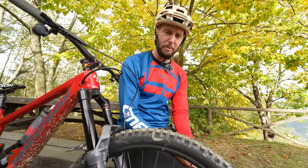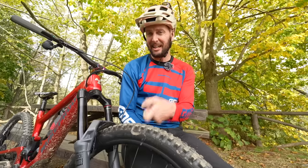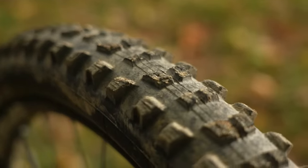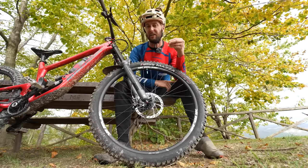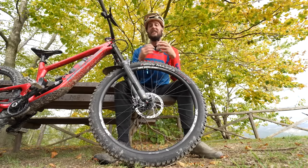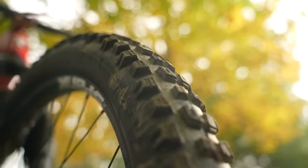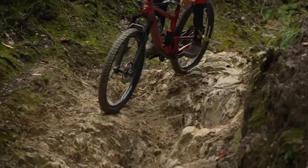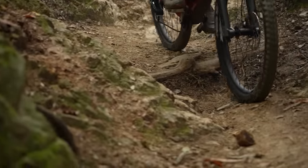It's not quite as simple as just letting a few PSI out of your tire. A lot of things can affect it, such as type of tire, size, and casing. There are all types of tires for all types of disciplines. We're obviously out here smashing enduro laps in Finale, so I've got an enduro casing tire. A tire's casing is measured in TPI — threads per inch — essentially how many threads are in per square inch. A lower TPI means the threads are thicker and therefore heavier. This is great for durability and strength and gives a slightly more damped feel, making it a good option for downhill or enduro tires where toughness is key and the extra weight isn't a big deal.